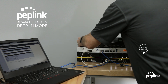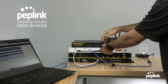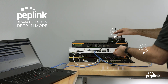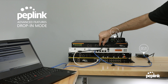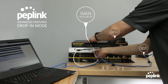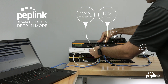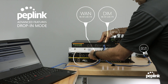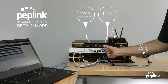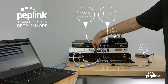We're going to bring the Peplink router into place right here. Now you have the Peplink router with its backup internet connection — ISP number two. Here's my LAN port going to the Sophos, and here's my WAN port. I'm going to move the Sophos WAN port to the Peplink, then plug the Peplink into the Sophos internet port. I've never made a single change to the Sophos. The Peplink is now getting a public static IP and passing it in drop-in mode to the Sophos.